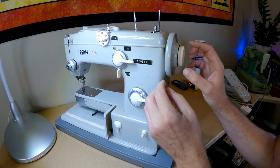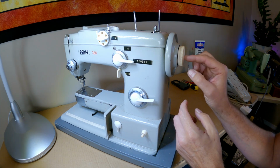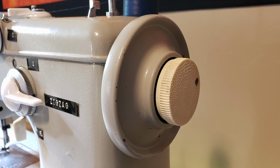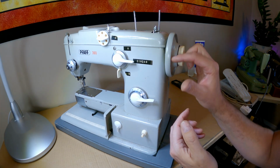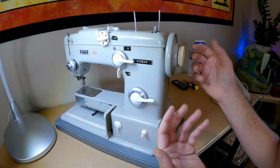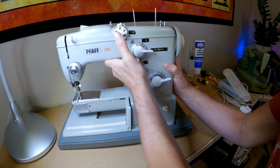Okay. Usually on the other machines, in my experience, that means that either this knob is installed wrong, or there's like ball bearings or something inside of there that have come loose and it's not disengaging the wheel, or the oil in the drum interface inside of this hand wheel is all gunked up and seized and not smooth and just needs cleaned and re-oiled. So add that to the list of things to fix, because that's super important.